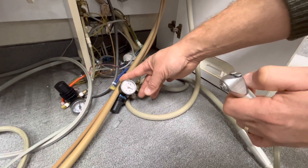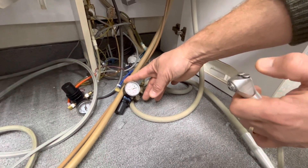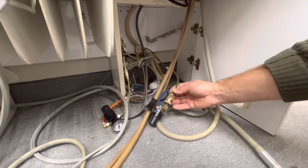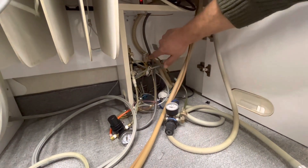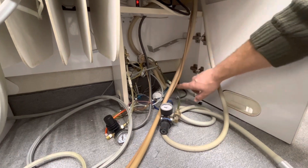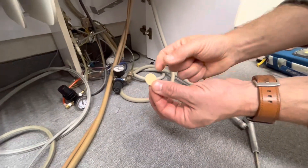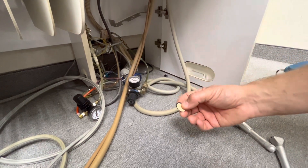It'll build back up slowly. When I push the button, that tells me the clog is basically affecting this area. As luck would have it, right here is a filter. Here's a valve — this is where the water comes in, a shutoff valve that turns the water on and off. The water pressure comes through here and then to here. I've seen this one before and this is likely where the problem is — inside here is a filter and an O-ring. I'm going to go ahead and replace those two, and that's what I believe will fix this problem.